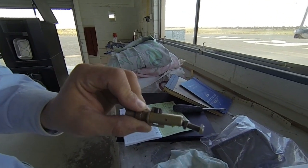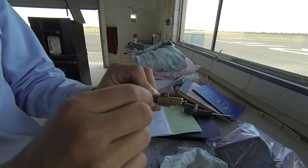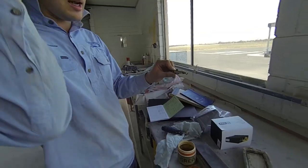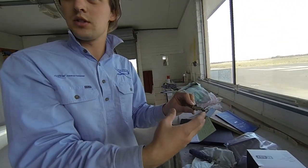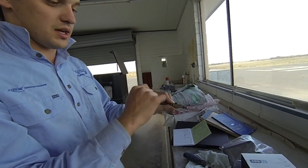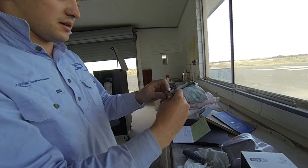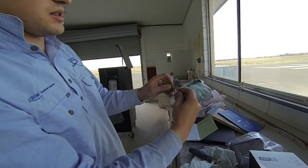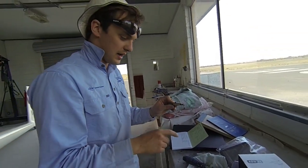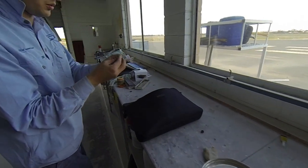You'll notice in the fuselage on this push rod there is a little R-clip, and what we need to do is put that R-clip through the hole. Every time you rig it you do an independent control check - you'll rig the glider, then get someone else to come along and make sure that each one of these is connected properly and that the safety clip is in. You'd have to be a bit silly, but you know, anything could happen.